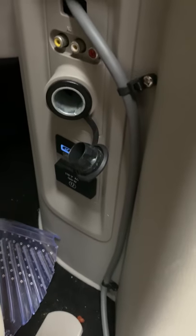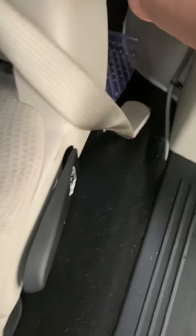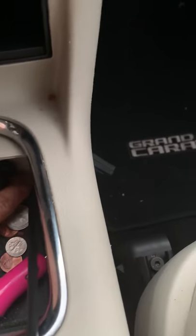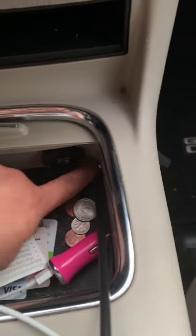Then I did two zip ties there and ran it through the bottom or through the side. I ran the cable through there and then through here. On a Dodge Caravan Stow and Go, you have the compartment down there — you open it and I ran it through there, then over there. I took off those little caps and ran my wire through there. Then I actually had a cone bit and I did a hole there to run the wire in, right in the corner, so it's actually hidden. You would have to really pay attention, but since it has this black cover, it really helps keep it hidden.